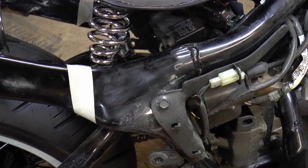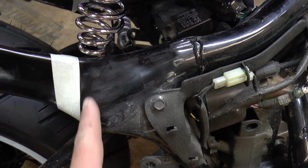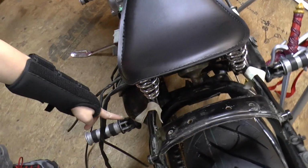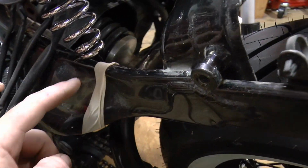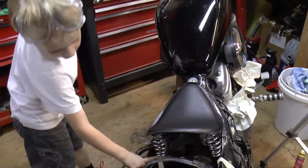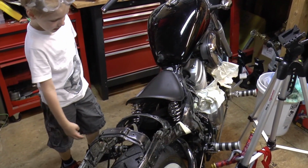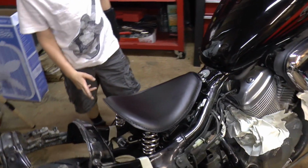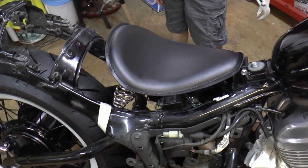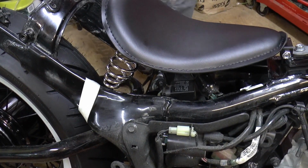Alright, I've marked this side and the other side with masking tape. I'm just going to take the Sawzall, make a cut right down here, and a cut right there, and a cut right there, and a cut right down here. We're just going to do it right here, but not on the tape, because when we cut it there, the tape is going to stick there for a long time, and I think we're probably not going to be able to get it off.